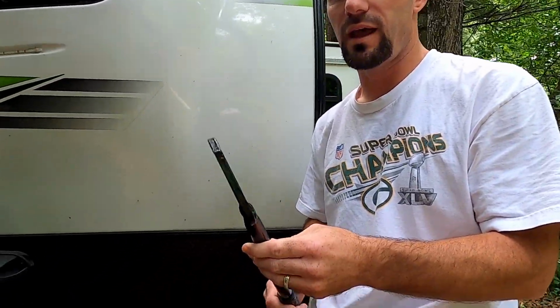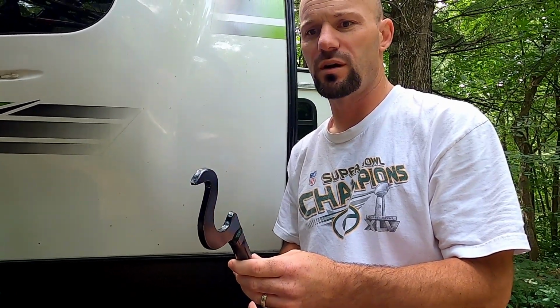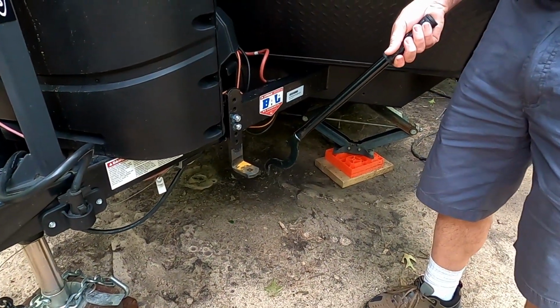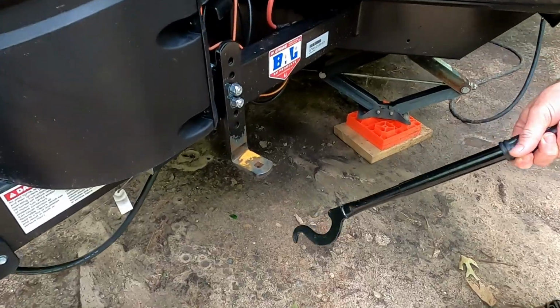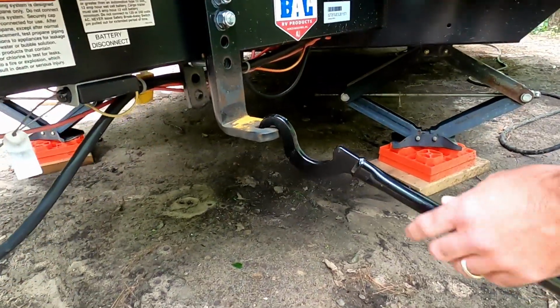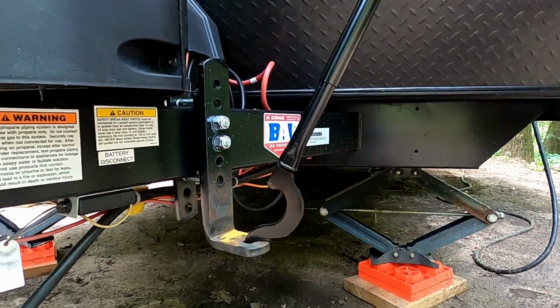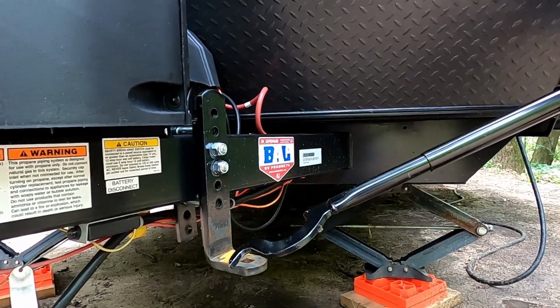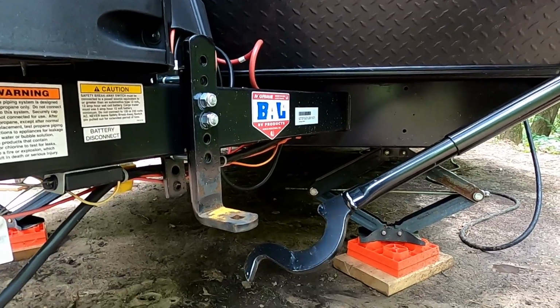So I'm not going to go over all the steps to actually hook it up to the travel trailer, because I do cover that in another video which you can watch and I'll link to in the description. But there is a tool that came with it that you can use if you're having trouble getting the bars up on top of the brackets. We've not actually had to use this because we used the jack to jack it up, but essentially if you were having problems, you could hook this here and then the bar would go in here, and when you slide it up, that would then slide the bar onto the L bracket. So this is a tool that came with it for us that can be used if you do have problems with that.